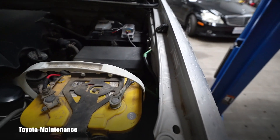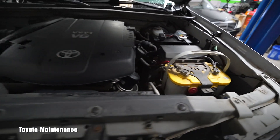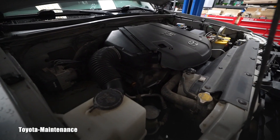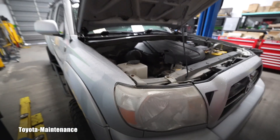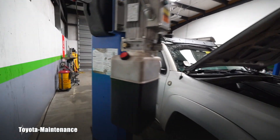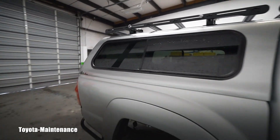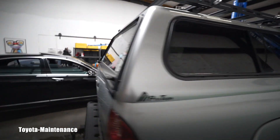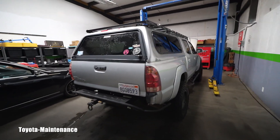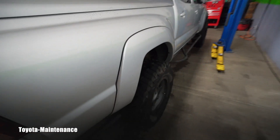The ground strap should be fixed because the battery has a different mount and didn't fit the same way as the OEM. It's a very good-looking truck. The customer also said: when I'm driving under load — not when I'm coasting, but under load — I have some vibration; can you check it out?